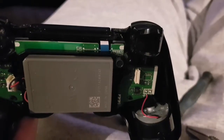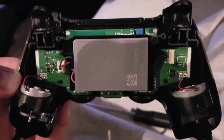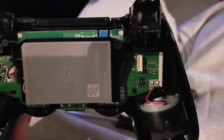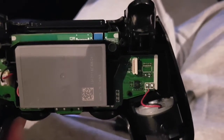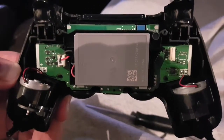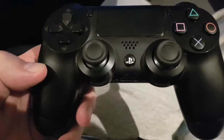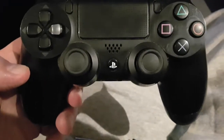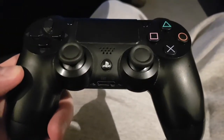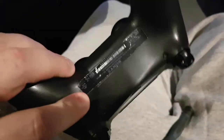Reset button's back in. Now all I gotta do is take the other half — don't forget to plug that other ribbon connector back in, blue side facing out — and snap the halves together, put the four screws in, and you're finished. New joysticks on, buttons cleaned up, nothing sticks. You can buy these joysticks on Amazon for like eight bucks.